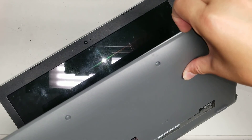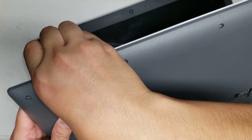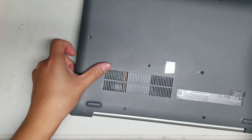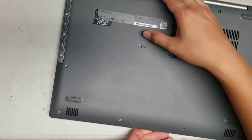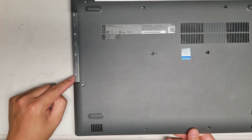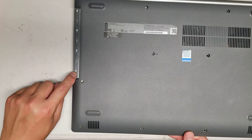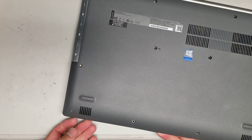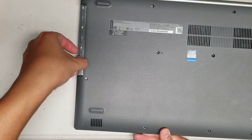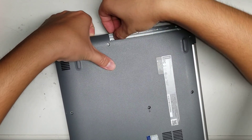Once you do that, you can start popping the case out. Push with your thumb on the back while you pull with your fingernails forward. If you have a pry tool, you can use that instead, but I find fingernails work a lot better. Just go all the way around, then go around to this side. These clips will be stuck a little bit, so you'll have to wiggle around the plastic. The little white clips actually go out to the side this way, so you want to pull the plastic for this bezel piece outwards — that should allow you to remove it. It'll be a little tricky, but just keep working at it and you'll get it.